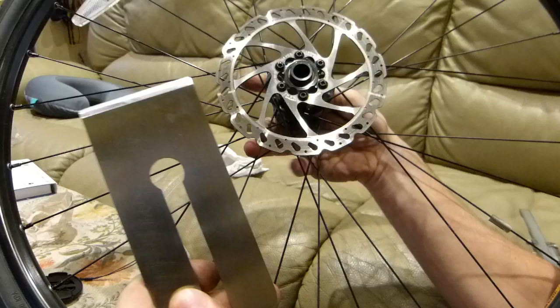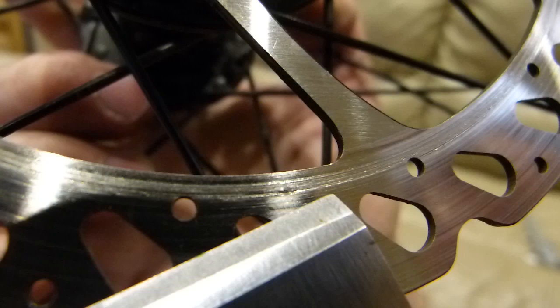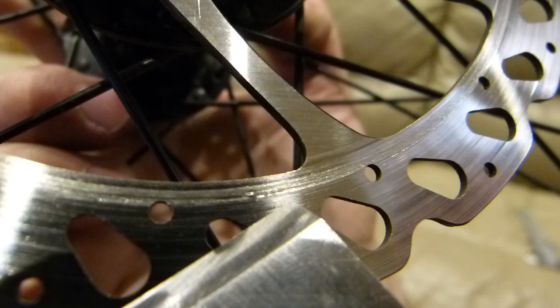I can show you with, don't get a heart attack at this point, this is a block plane blade. I just want to show you that this is a raised feature that shouldn't be there. Let me just try to stabilize the picture, and I'm sliding the plane edge. There, you can hear it, that I'm hitting this lump with the edge of this plane, okay?